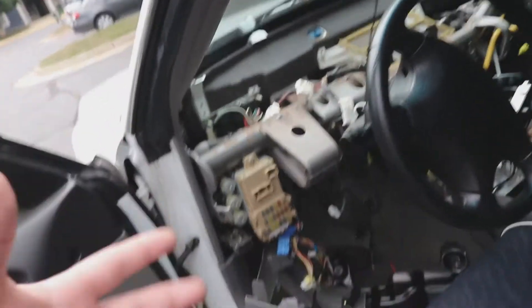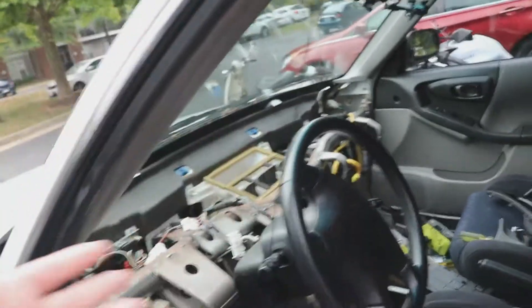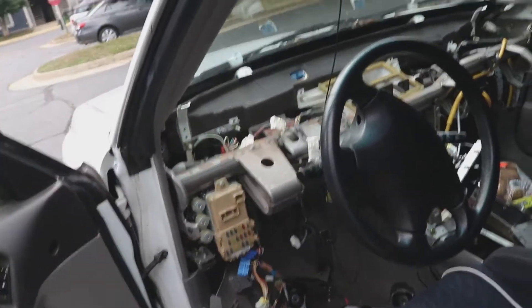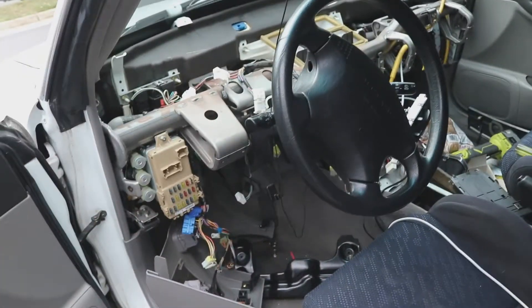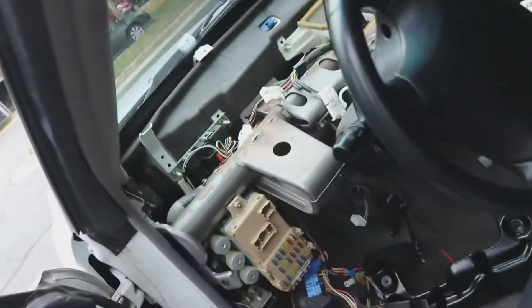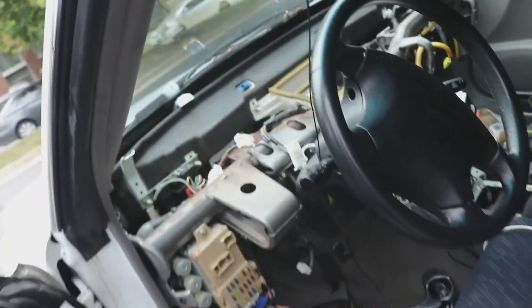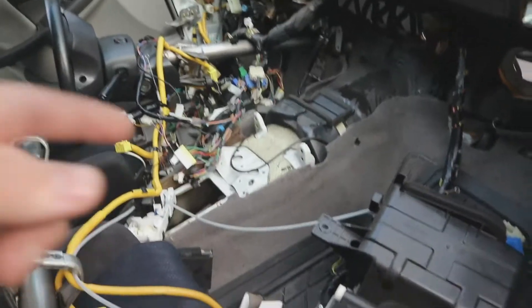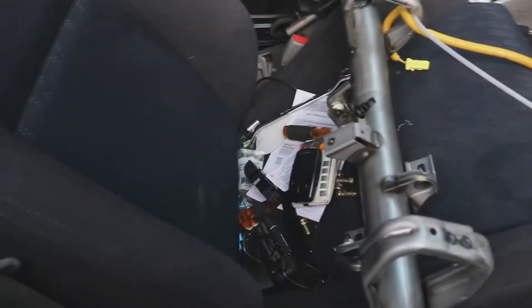Unfortunately we're now at one of the bigger steps — taking out the HVAC stuff so we can take the entire harness out of the car. I'll leave a link below to a really detailed article for anyone doing this in their older SF5 Subaru, from one of the Subaru forums. All I can say is it's a lot of bolts and a lot of nuts. We've got to take this whole crash bar out and also remove all the HVAC stuff. The torx bits, if you're doing this yourself — size 40 — they hold the airbag module in place.